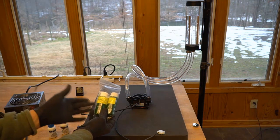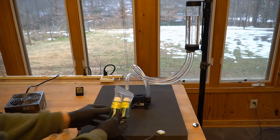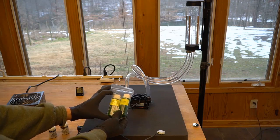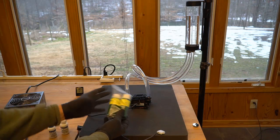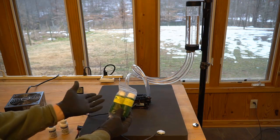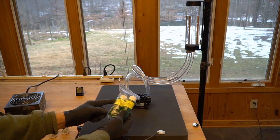concentrated coolant. This is the same coolant that you got with your system. It's fantastic. I use this on all of my systems. It's the longest lasting stuff I've seen. But this is concentrate, so each bottle will produce half a liter of finished fluid. Please use distilled and deionized water. Well, distilled water is deionized anyway, but deionized, it has no minerals in it and no metals, and it's distilled, it's clean. So use it with this material and you'll be good.